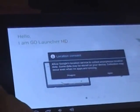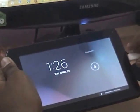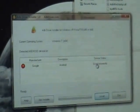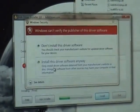The flash process is done but the touchscreen is not working. You need to install the touchscreen drivers. Insert the USB cable into the tablet — USB debugging will connect automatically and you'll see an unknown Android device. You need to download a file called the ADB Driver Installer. After downloading, open it and you will see that the device structure driver is installed incorrectly — install this driver software.